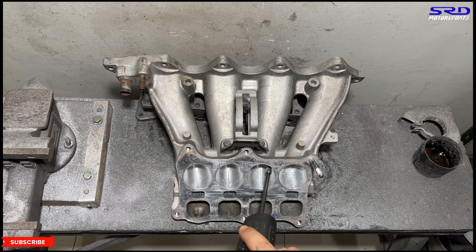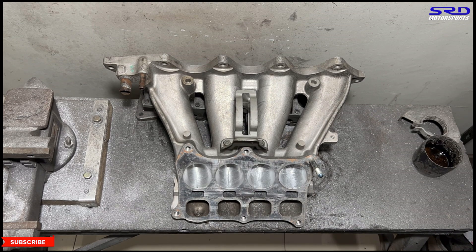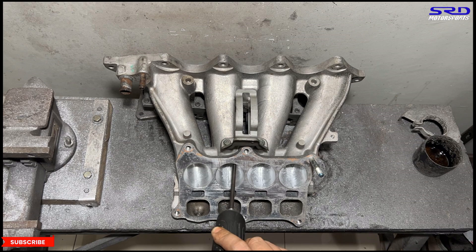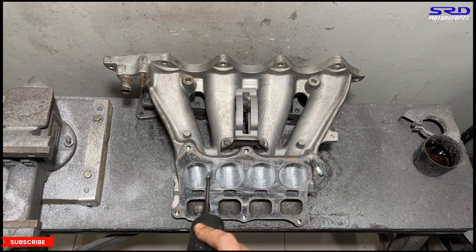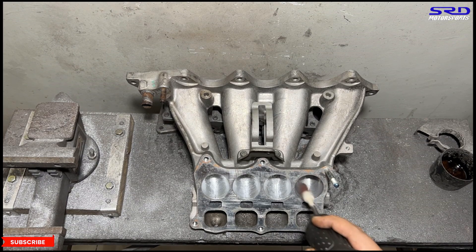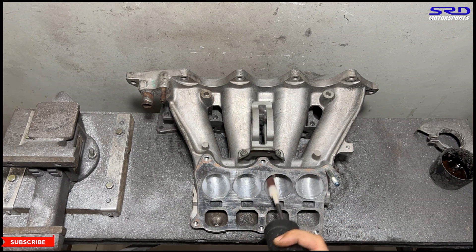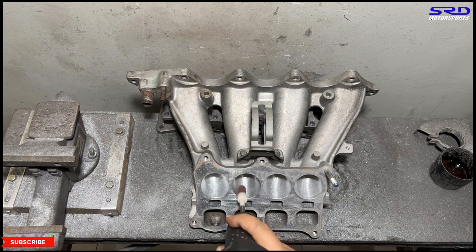Some of you may be wondering why we're doing this. Think about it — a P30 B16 intake manifold has long runners, and if you increase the plenum volume you slightly increase top end while retaining the torque because of the long runners. Same with a Type R manifold — increase the plenum and it gets stronger. Same here: increasing the plenum volume will help both runners. It probably gains around three to five percent on both the short and long runner by porting this on a GSR.